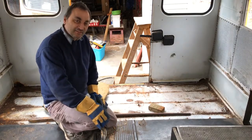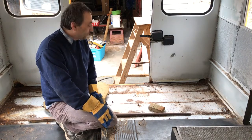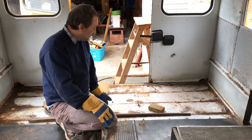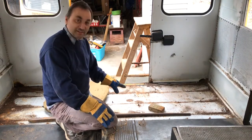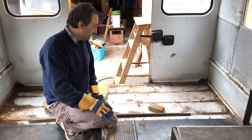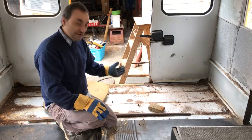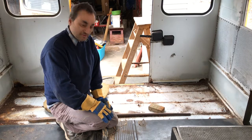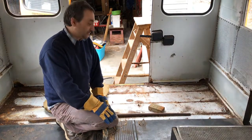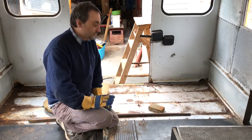Welcome back to Life the Wild Ride. This is the next video on the bus conversion. Last week you saw us getting the last of the seats out, and I mentioned that we started on the floor — that's where we're at today. We did take the first section out last week. This has proved to be a real pain, at least the first one, because they had so much silicone — high-quality silicone — it would stretch and pull the piece right back. There are nails down through the plywood into the metal floor, screws and nails that we have to pry the plywood up out of. I was so excited to get the seats done, but I think this floor is going to prove to be a bigger challenge. If you're considering building a schoolie, make sure you know what you're getting into. We gave ourselves a long time — a couple-year build — so we're fine with it.